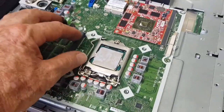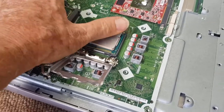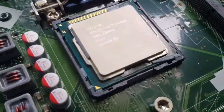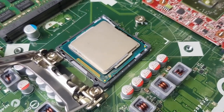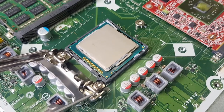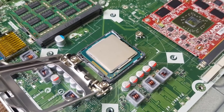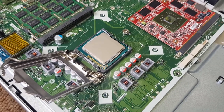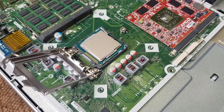I've got all the wires unplugged. We've got to see what the CPU is — it's an i5. Maybe i5s are still worth selling. I do need to be careful with these in that if I'm going to sell them I need to know how to post them. Apparently they need to be posted in a static-free plastic bag or something like that. I'm even a bit hesitant to take it out and handle it — I don't know how sensitive they are. So if you know a bit about these things let me know in the comments. I don't want to accidentally drop it, shove it in a post pack, put it on eBay for 20 bucks and have it shorted out from static. I don't want to get a bad reputation as a seller.